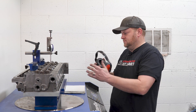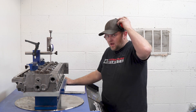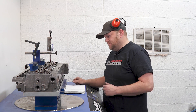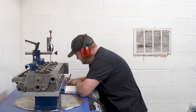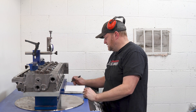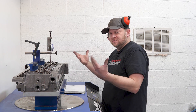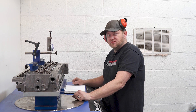100 lift. All right, we are on range 3 which only reads accurately to about 95-96 CFM — and we're already over 95. It gave me a little arrow saying go up a range. Now we're on range 5 for 200 lift. Wow, this thing really took off at 300 — we're over the 195 CFM it can read on range 5, so we're up to range 6. Essentially it's just internally moving plates to open up orifice sizes to hit a range of vacuum so it can run across the sensor. Too much flow — which is a good thing.